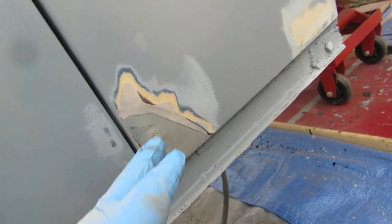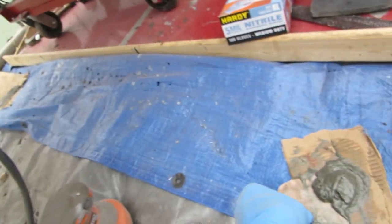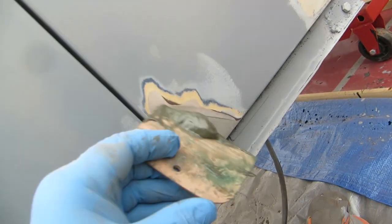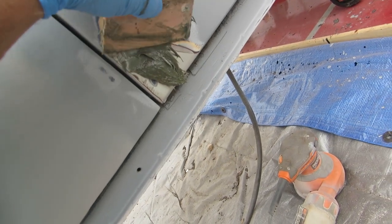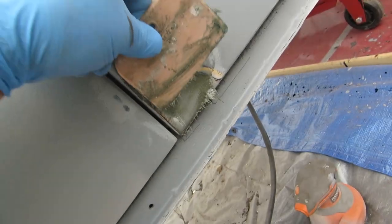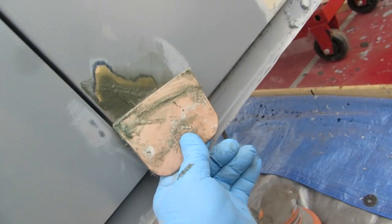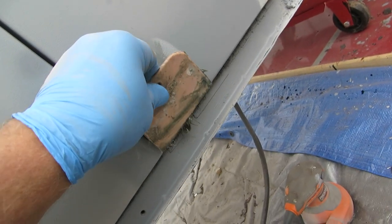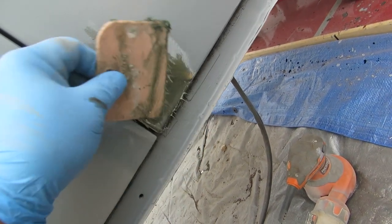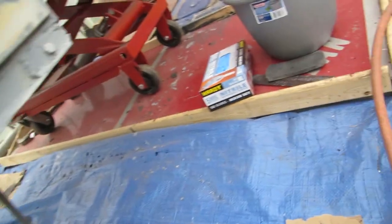All right, we had some cracks here that were appearing, and this is what I call a rusty trombone. And the reason why I call it a rusty trombone is because somebody really did you dirty. Okay, so essentially what they did is they drilled a hole in this. You can see the hole right there. In order to get their mud, which they are laying on here in about 3/8 of an inch, which is, if you got more than 1/8 of an inch of Bondo on your car, not fiberglass, I'm talking polyester, it's wrong, okay? If they're doing their job and pulling these dents out, then they shouldn't have to do a rusty trombone on it.